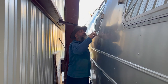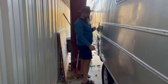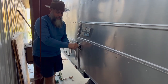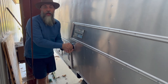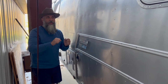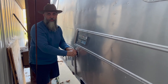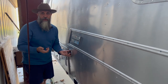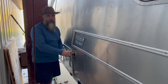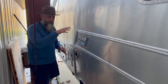This is the window to the bathroom. Further down is the hookup for curb water or city water — you just put a hose on here and you can run it constantly for city water. This also has a pressure reducer on it, so it will reduce it to 40 PSI so you don't blow any of your faucets on the inside.